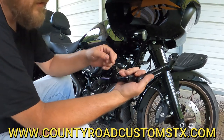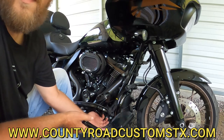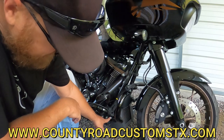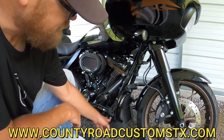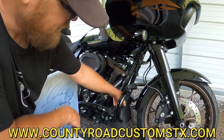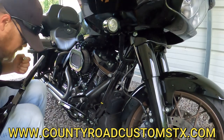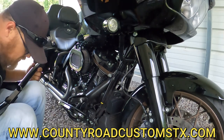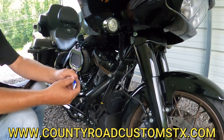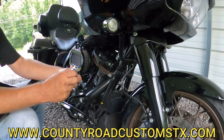My mic was apparently a little loose. What I am doing is pulling off the Zero 3D floorboard-mounted highway peg to get access to the Torx bolt right here that holds the lower crash bar on. There are two bolts — you can just loosen up a little and lift the crash bar off after the two lower bolts are removed. Make sure you use your Loctite when you put your hardware back on, because you don't want to drop it on the road when somebody's behind you.